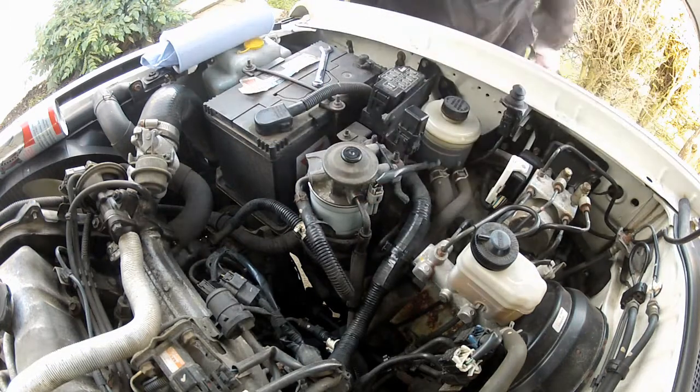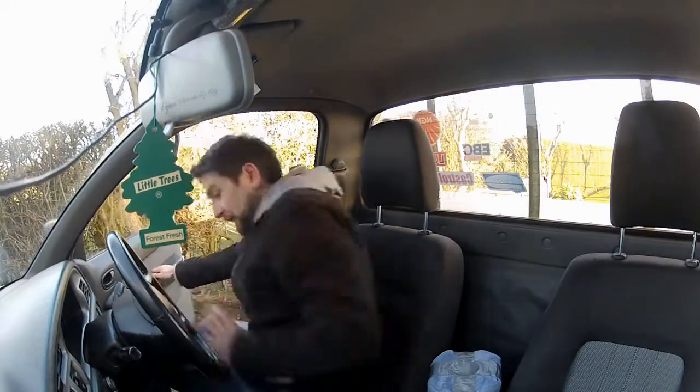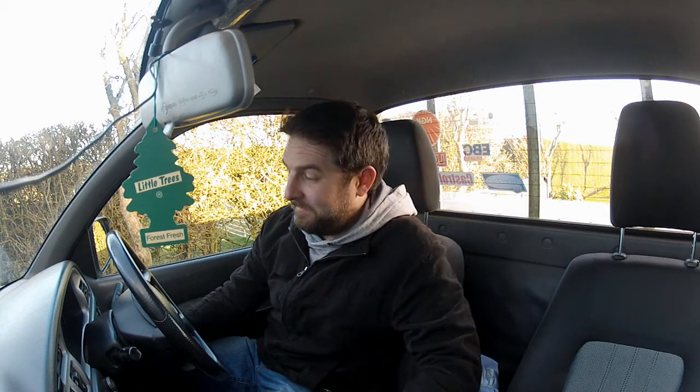Okay, finally we can start the engine. Now if you've got an electric pump before your filter - either in the tank or in the line itself - you might want to cycle the ignition a couple of times just to further prime the system. That's not the case with this vehicle so I can just go ahead and hit it. Wait for the glow plugs. Boom, there we go. Just check for any obvious leaks before you close the bonnet and you'll be good to go.